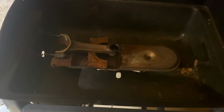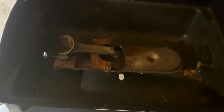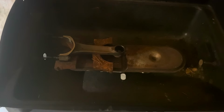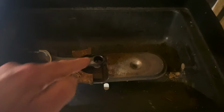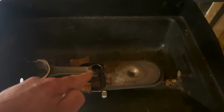I would say if you have a 4-burner grill, this is the size of 1 burner, so just take the BTUs of that 4-burner grill and divide it by 4. For this many BTUs flowing out of this grill, it takes about 1 minute and 30 seconds. I leave the flame on high, both sides, with all the nozzles pointing toward the small end of the rod. You don't want to heat this end. It doesn't matter. You're just trying to heat this end.